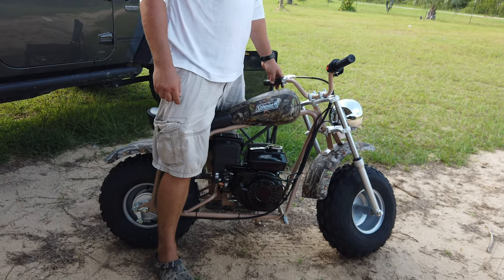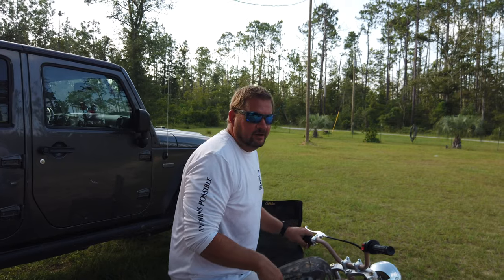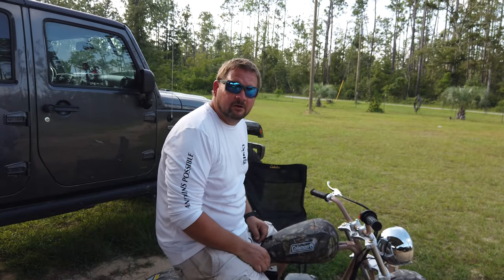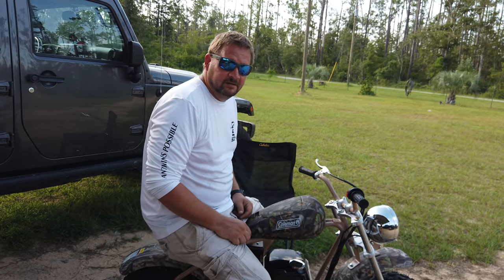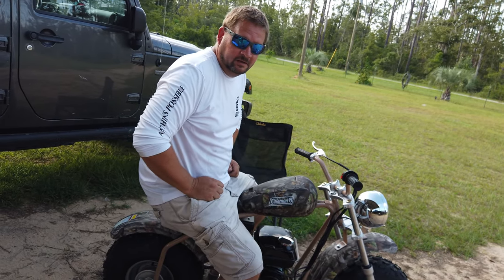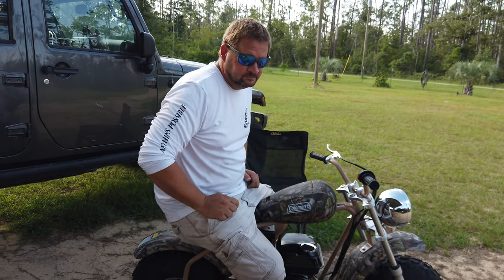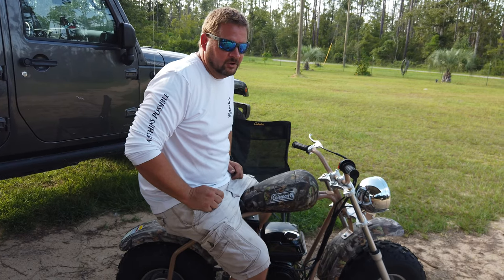Now, is there a break-in period? Supposed to be. I haven't read the instructions or anything. I would definitely take it easy for the first half hour. Don't over-rev it. Get it nice and hot, and then let it cool off real good. And you can do that a couple times, generally given they're broken in. They do test run these things in the factory, so maybe that's enough. Mishka, come here. I'd go easy for a little while first.